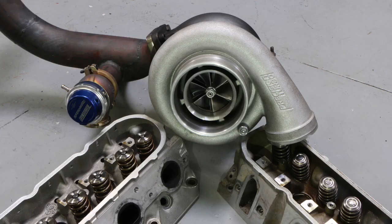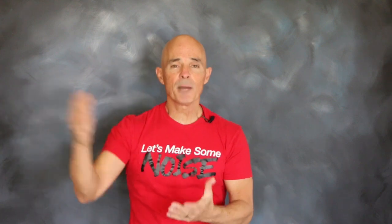To bridge the gap between NA and turbo testing, on this particular test I did both. I compared a set of 706 heads to a set of 317 heads, both naturally aspirated and turbocharged. Back in the day, and probably still now, 317 heads were a big upgrade for the 706. Lots of guys put them on, especially for turbo combos. It offered more flow and dropped the compression — both things you want in a turbo motor, right?